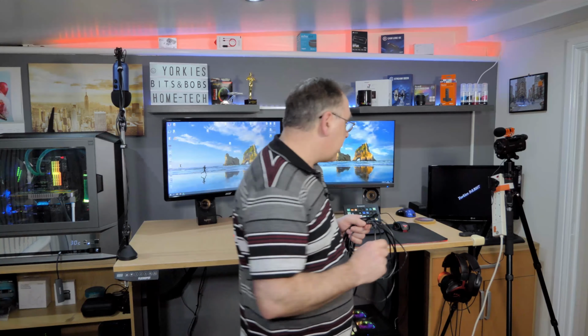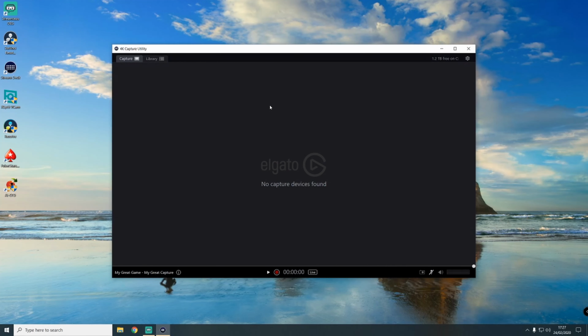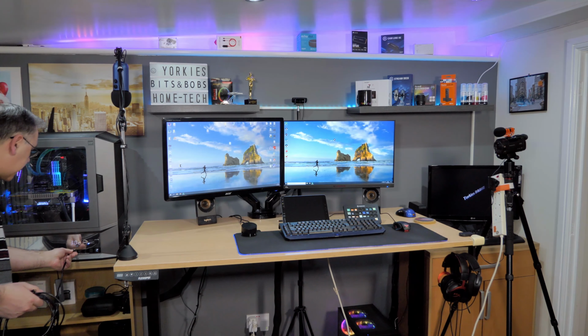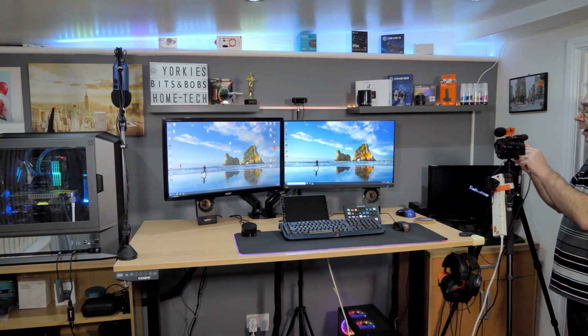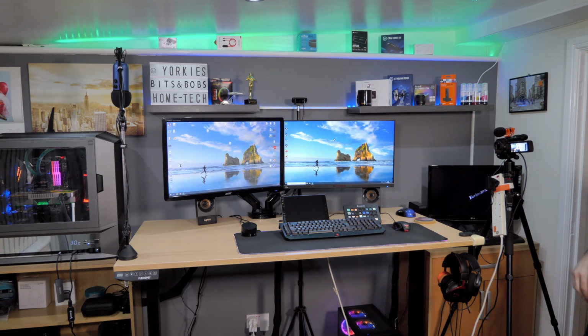So now, you've downloaded the software. It's all running. I'm just going to quickly show you something. We'll click on the 4K. Obviously we haven't plugged anything in, and that's what you're going to see: no capture device. So we're going to close that down. Now what we're going to do is plug this in. Plug into the USB 3, and it must be USB 3. It will not work on USB 2, so don't even try it, especially if you want 4K. And the other end goes into my camcorder, like so. So that's all plugged in. I'll show you the screen now, all up and running.